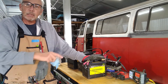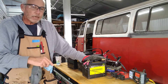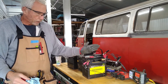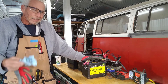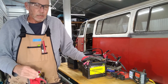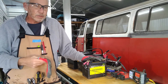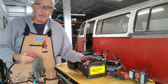Then I went through and added water to the batteries — I checked the cells and used distilled water today. You could use distilled or deionized water; you can get that at any grocery store. Working with batteries is not safe. I use these gloves — nothing special, no sponsorship. I get them from Sam's Club or Costco. You can get them anywhere; I buy a big bag and use them for everything.